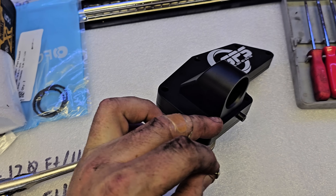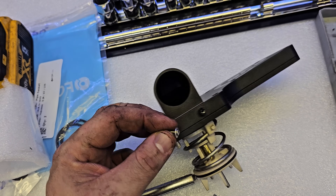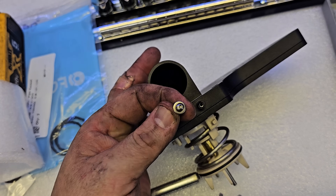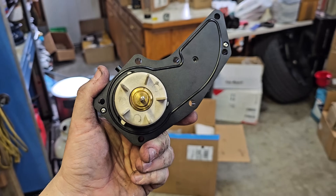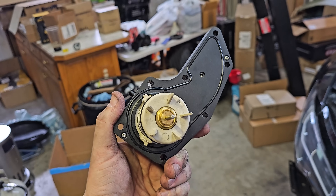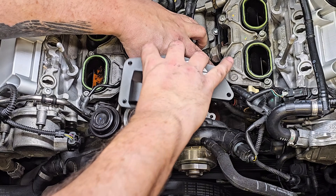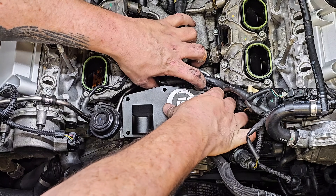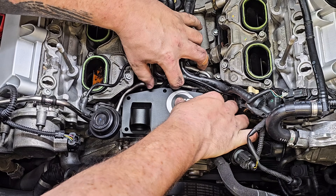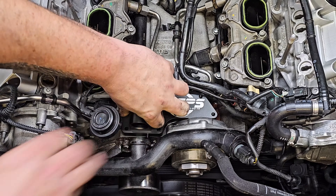A little bit of prep work before moving the housing over to the car: it comes with its own screw to connect the crossover pipe to the billet aluminum housing — this is a number two Allen, so it's super tiny. Take that out before you install the thermostat housing. As you're carrying it over, you'll see a gasket in there — make sure you do not damage the gasket as you set it down. If you get any debris in there while cleaning, make sure you clean it all out. Carefully position this into the engine bay, moving wires as needed, and set it down flush over all the bolt holes.